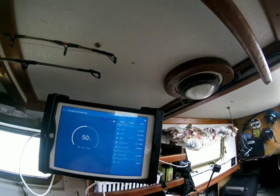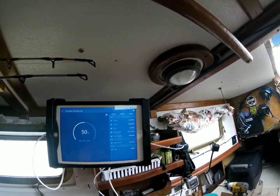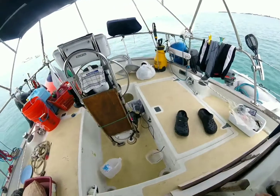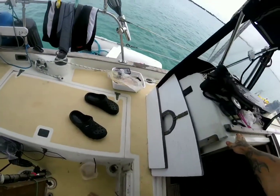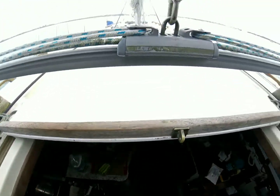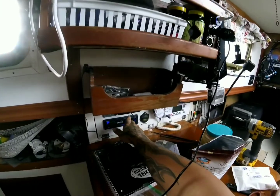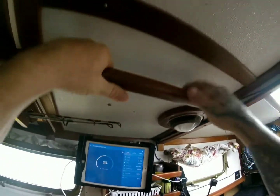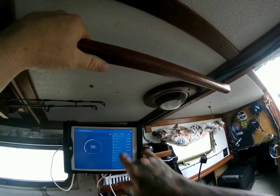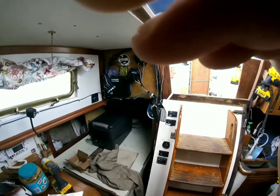So now we're putting in 50 amps. So 50 amps, and I'm gonna turn it all the way on. I'm gonna give it a little more fuel before we do that, because it's a big load on this alternator. It's a Balmar XT170, and it works at a low RPM. But watch, so small engine mode's off, so now the alternator's hitting hard. Now we're putting in 135 amps. So 50%. So in about 2 hours, I should have about 200 amps in there.